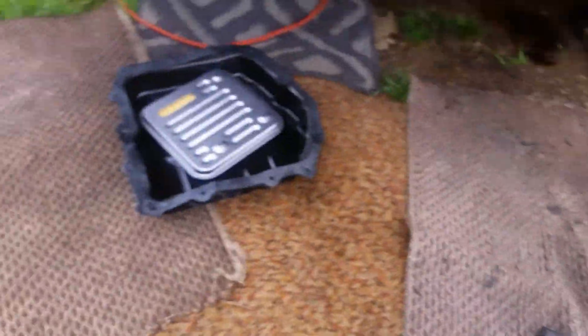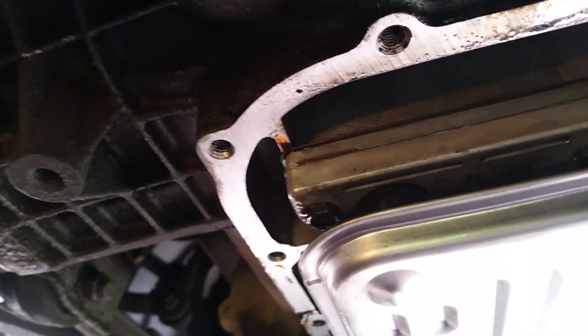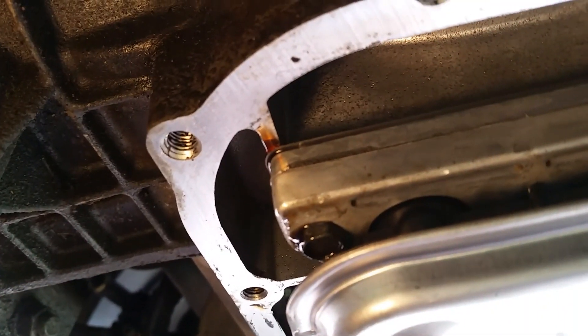All right, so let's go ahead and get this on. Make sure you take the old O-ring out if it's still up in there. Wipe it out a little bit. Don't worry — it'll never stop dripping; it's just one of these transmissions that'll continue dripping. Put the filter up in here — there are a couple of holes right here where it goes in, you'll know when it goes in. Set the camera down to get that O-ring seated all the way. Now it's seated — take a light and if you can't see the O-ring, it's up in there correctly.